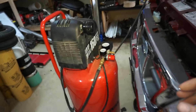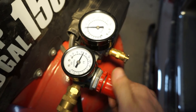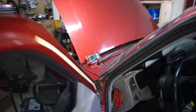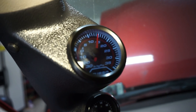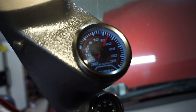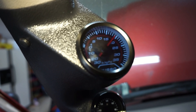So I'm going to turn on the buzzer and turn the pressure up. This is going to go really high, like 60 psi. You can hear it kind of turning off already, but the problem is it's intermittent and it's turning off already way below 15 psi — it was kind of on and off intermittently while it's swinging between 5 and 15.